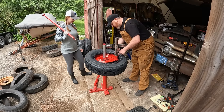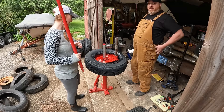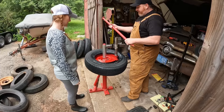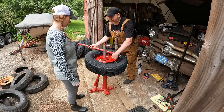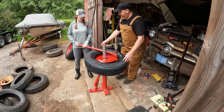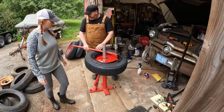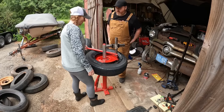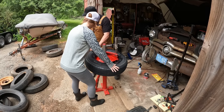The bead goes over the front lip and then under the duck head. So what you're going to do is walk this — stick this like this — make sure this doesn't fall into the wheel or you'll destroy it. Hold this, stand on that side, and push down. You're going to pull it in a circle while I hold this. Put your arm out like that.